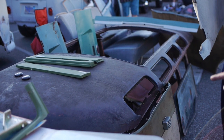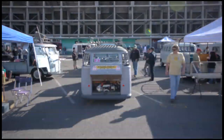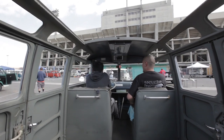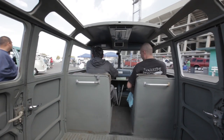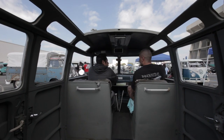Into a 23-window Samba. The Electric Samba was the topic of conversation all day and I had a chance to take a few people on a ride around the parking lot. I managed to burn off a whole 20 amp hours just joyriding, so the Samba had to make the 50-mile trip back home on 160 amp hours — meaning I had to average 384 watts per mile.